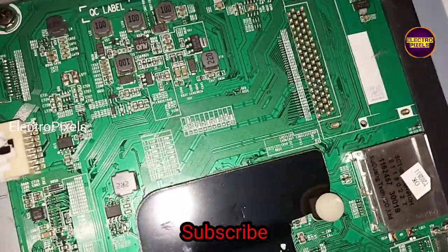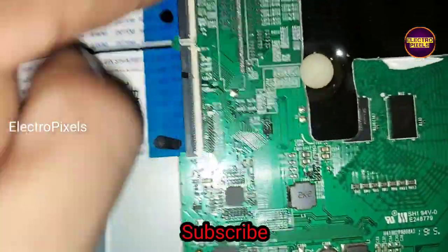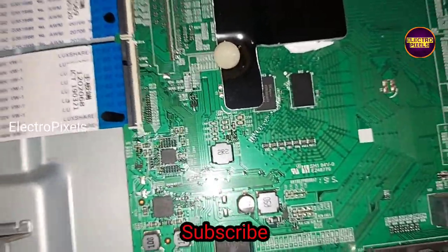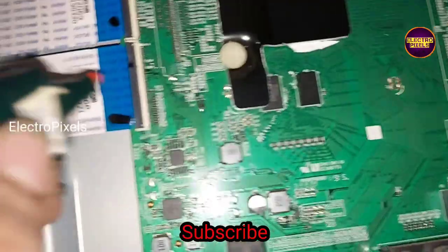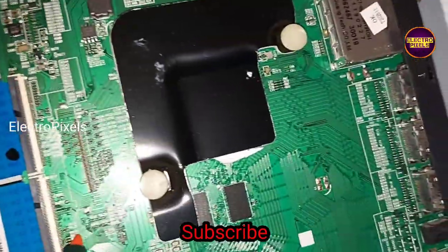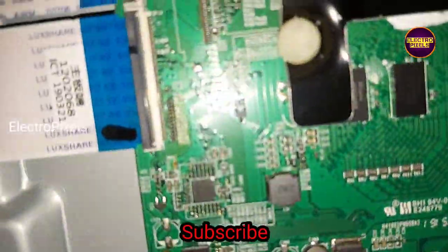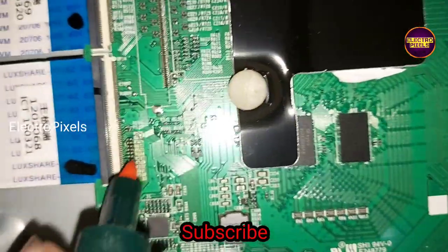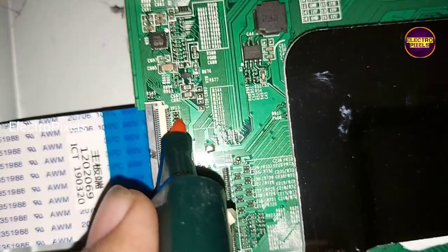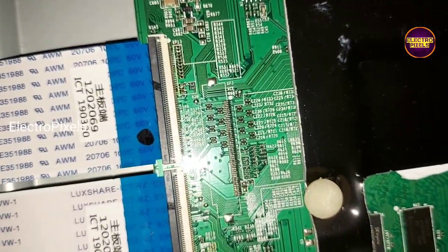If any one side of the panel is good, we can repair it easily by blocking the gate signal tracks. At the end of the video, I will show you the gate signal tracks that we need to block. These are the gate signal tracks — you can block these gate signal tracks using the taping method.